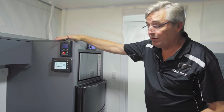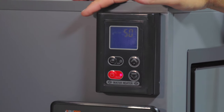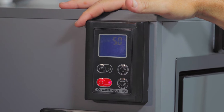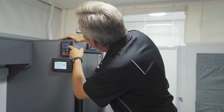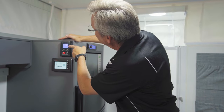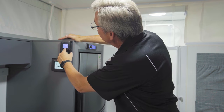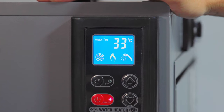The other box we've got here is your hot water unit. So the little red light indicates that it's got power. So that little switch here outside's on. If I was to run your hot tap now, we'll see that light up. So the magic of TV, we'll just run the hot tap. As we get a water flow, you'll see that it's got water flow. Then over here, we'll see a little gas symbol light up to say that it's lit on gas.